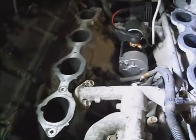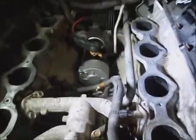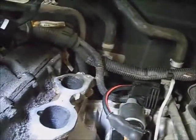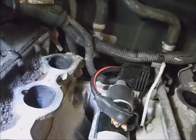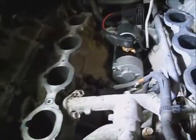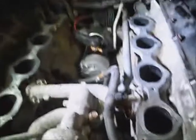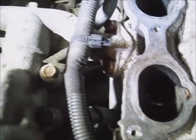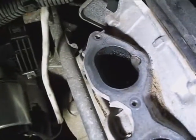And your guards are out of the intake ports. Make sure none of the cables are blocking where the intake's going to set, particularly the battery cable and starter wire. Make sure there's no particles loose on the heads around the intake ports, and then all of the paper towels are out of the ports. And it wouldn't hurt to look down into them to make sure nothing's fallen into them. It'll be a mistake if you don't and something's fallen into one of them.